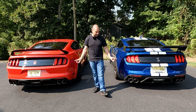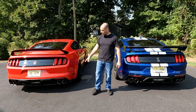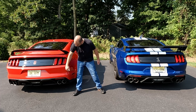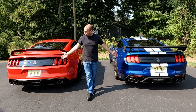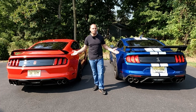Finally, the exhaust tips are another difference on these cars. The GT500 has larger tips, and they're actually built into the pipe and the muffler itself. Versus on the GT350, the tips are bolted onto the bumper and the exhaust pipe basically just mates up to them — done as a sort of heat shielding to keep it from melting the plastic, since the plastic does go underneath the tips themselves on the GT350. On the GT500, there's nothing below the tips. Some very significant differences overall, but both these cars basically have the same setup on the rear. I hope you enjoyed the video — thanks for watching.